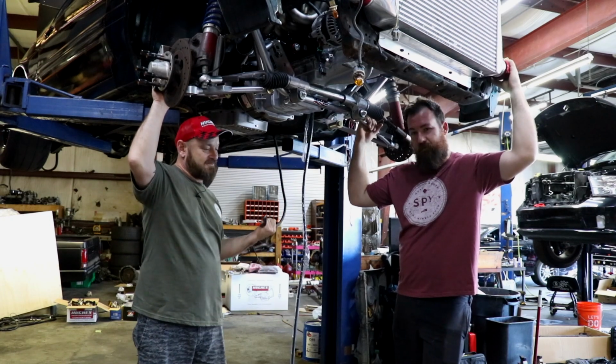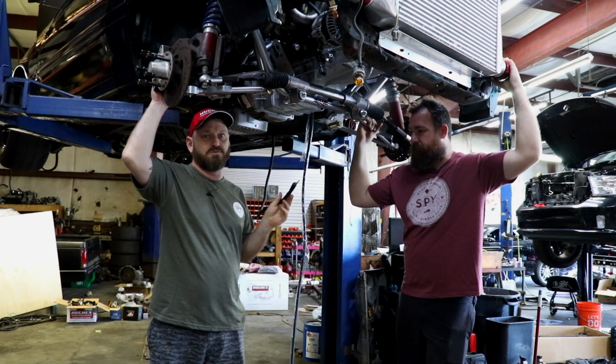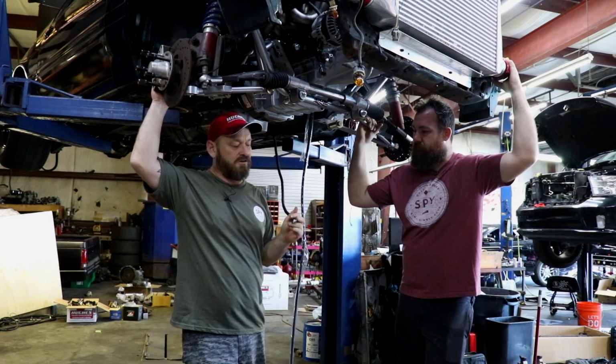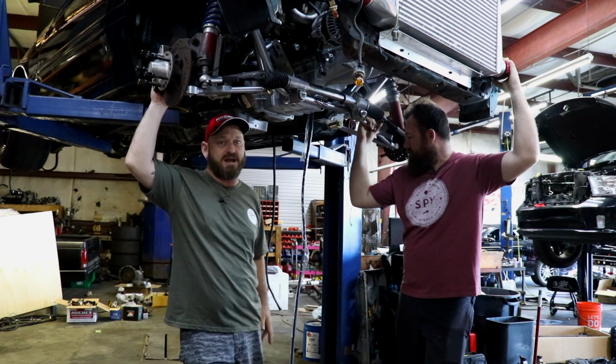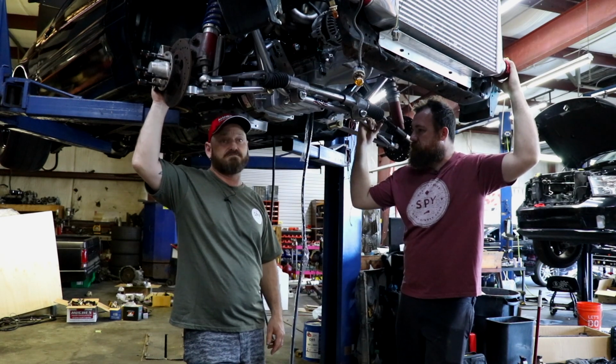It's far out. There's some pretty bad damage on the boot floor. Battery cable runs under the car, which is not a great idea in my opinion, so I'm going to pull that out and put it through on the inside of the car instead, so it's protected.